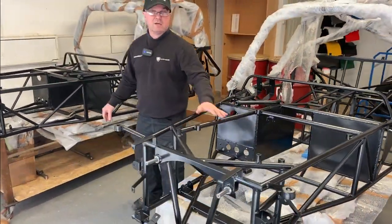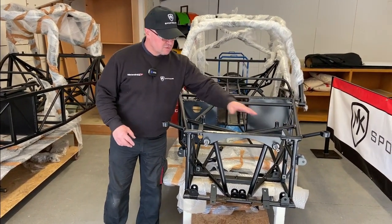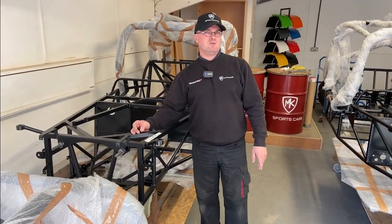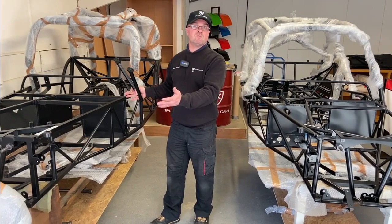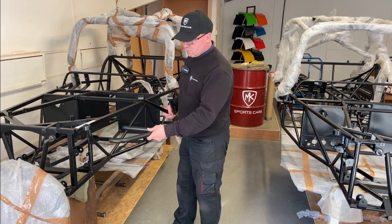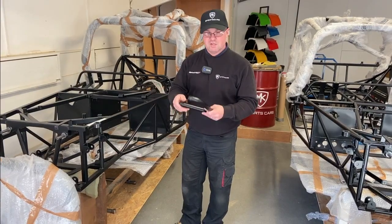Different engine configurations fit in both vehicles — bike engine or car engine in both options. The Indy RR has welded-on bosses for all the anti-roll bars front and rear. Normally the Indy R doesn't have them, but this customer requested them for more track use. You may have already bought or built an R chassis and later decided to get into more track day use — you can fit an Indy RR wishbone onto your R chassis and convert it to a fully adjustable, fully rose jointed setup, even just front or rear wishbones if preferred.